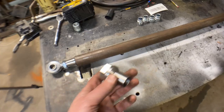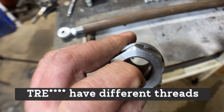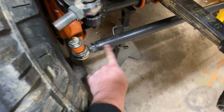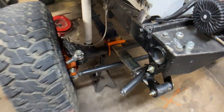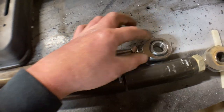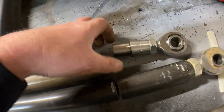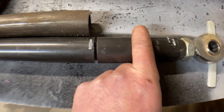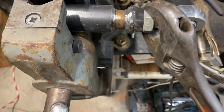Story time - I made a funny little screw-up with these joints. I ordered them from Barnes to make this new linkage - they're awesome - but I accidentally ordered the tie rod ones: they're seven-eighths by 18 threads per inch. I need seven-eighths by 14 threads per inch, so they're not gonna work. This one already has the right threads but it's just too long, so I can cut it down and weld a new one in. I was gonna make a new one with some crappy three-quarter ones just to get by, but literally the entire joint is outside of the tube - it ends right there and the joints are smaller. So I said to hell with that, chopped this down, and I'm gonna try to cut the old weld out.